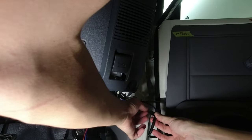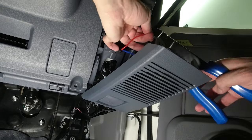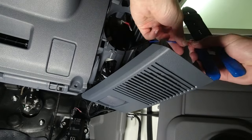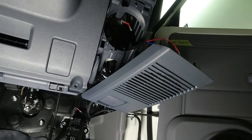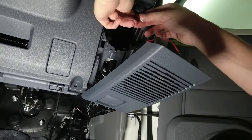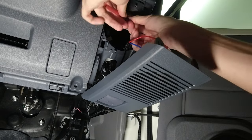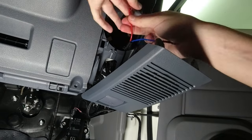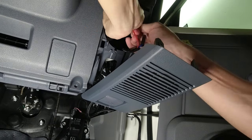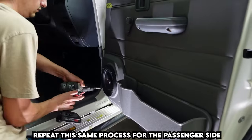I ran the wires up into the dash area and connected the spade terminals before heat wrapping them to prevent them from touching each other and causing electrical problems later. I also recommend cutting and terminating the wires unevenly — leaving a length difference between positive and negative — as this will also help avoid the terminals touching should your electrical tape or heat shrink fail. With all the wiring in place I can now put back the factory speaker cover, finish screwing in the new speaker, and attach the speaker grill. Now let's listen to how the new system sounds.